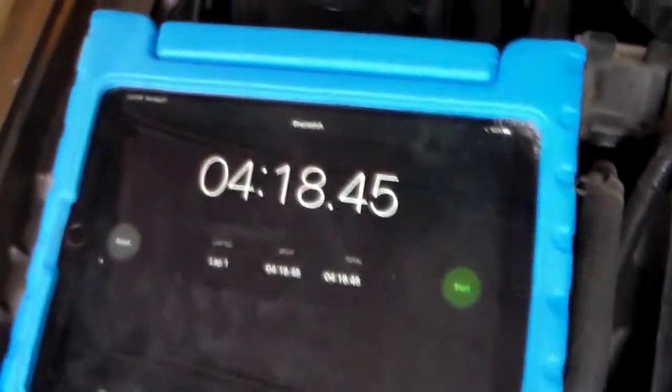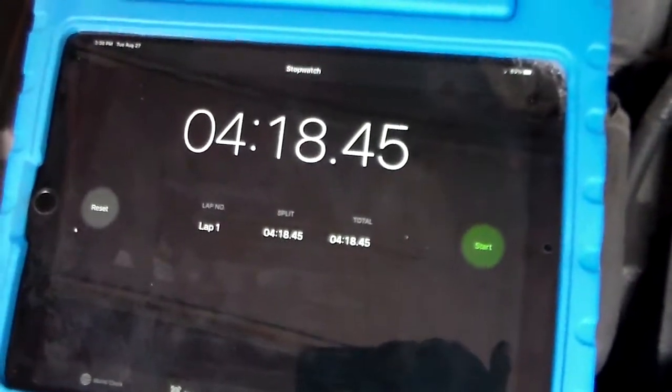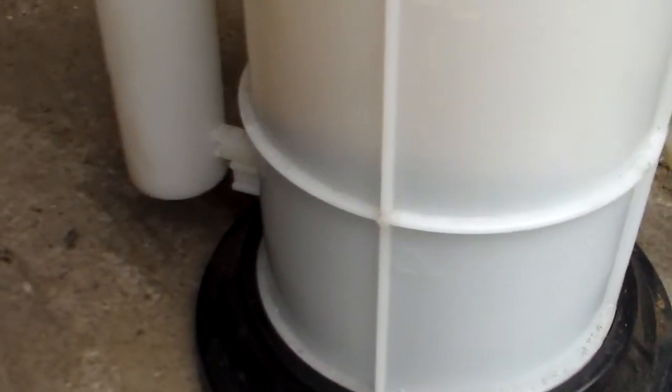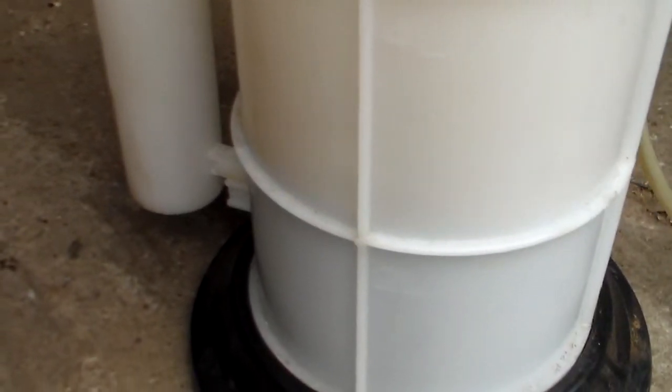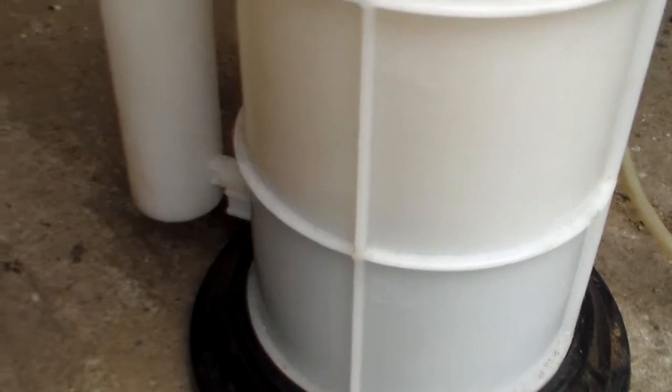When it quit running, it was four minutes and 18 seconds. I've used this on my Toyota Sienna and it worked well. But here, we're going to see how much oil is left — it only took a little over two liters out, which is basically two quarts. This car holds five and a half quarts, so it's apparently not the most effective tool for an oil change on a Taurus with this dual overhead cam engine.